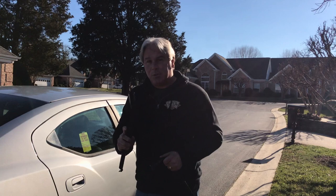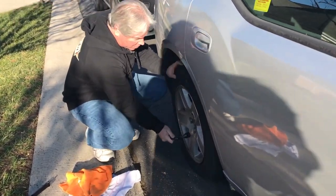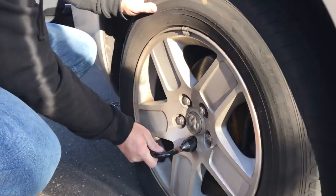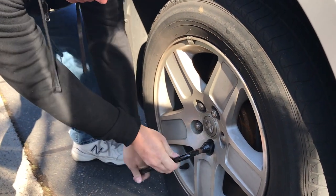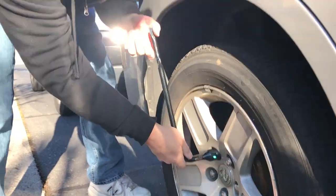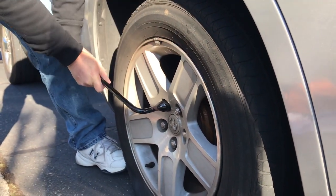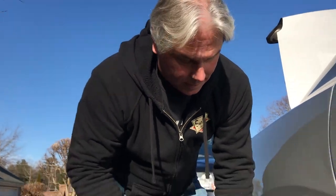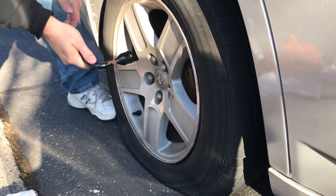We're still going to be able to use this to put the jack underneath our car. First thing I usually do is I get my lug wrench out and I loosen my lugs, making sure that before I lift the car up, my lugs can turn. That way when you get your wheel up, you'll be able to get your wheel off quicker without having it spin. You don't want to get it up in the air and realize you can't get your wheel off because your lug nuts won't turn. So while it's down on the ground and you have some friction to hold it, loosen your lug nuts.